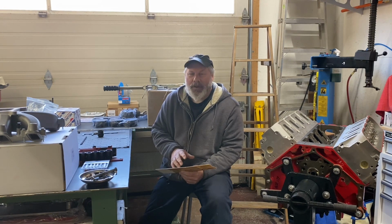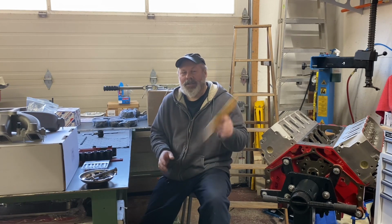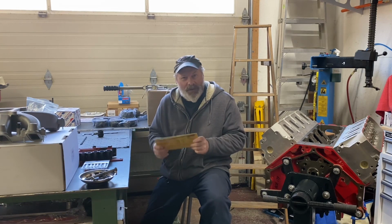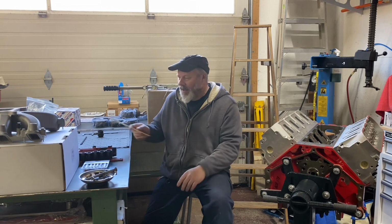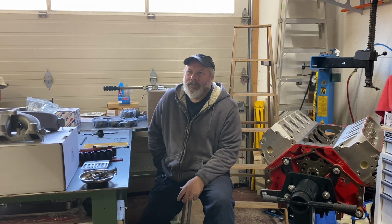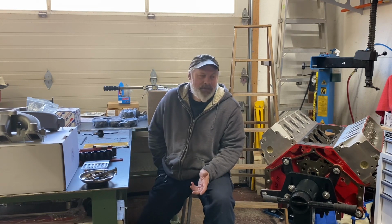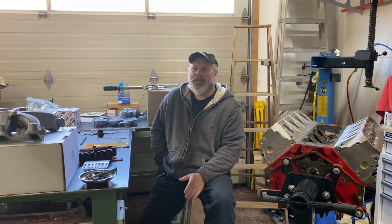I knew approximately how much horsepower I needed, and when I was all done, I exceeded the calculator that I originally got when I wanted to go fast. It took me 20 years to do it, but I finally exceeded the capacity or the capability of the power speed calculator, because I went 7.50, 179.99 at 2,675 pounds is 1,450 horsepower. That I built, just another piece of junk I built actually in my other garage, but built it out of parts, nothing special. And my goal was to run in the 7s in the 1/4 mile without the nitrous.